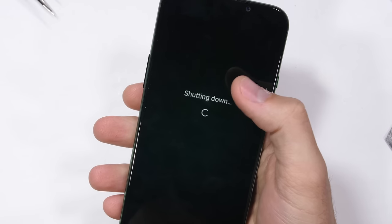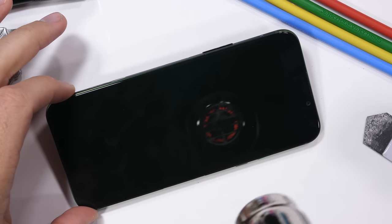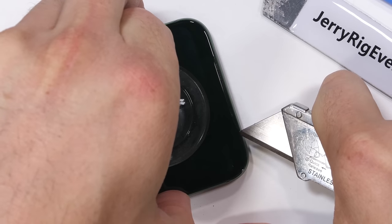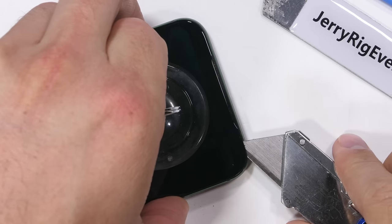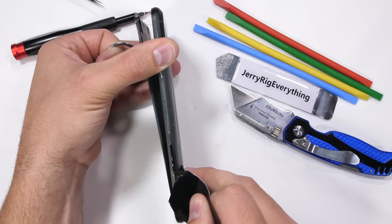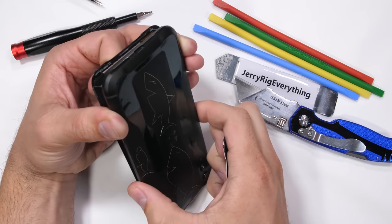Taking apart the Black Shark 2 is pretty rough. Instead of a non-essential rear glass panel coming off, this phone starts with a screen removal, which is both good and bad. Good if the screen is the only thing you need to replace, but bad if you're trying to fix basically anything else. The screen is set down inside the subtle green and black metal frame, but once the initial penetration is made down near the lower stereo speaker, the adhesive lets the screen pull up and away fairly easily since there's no super strong waterproofing around the edges.